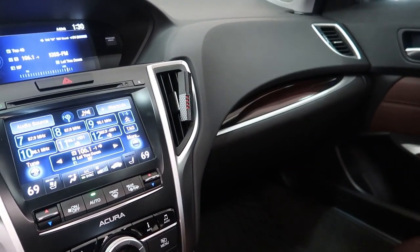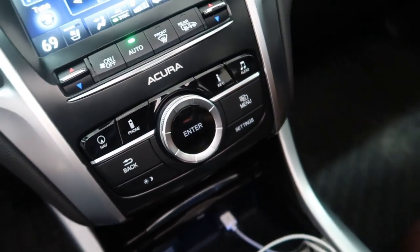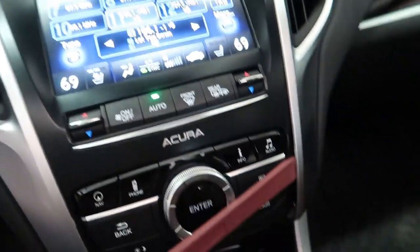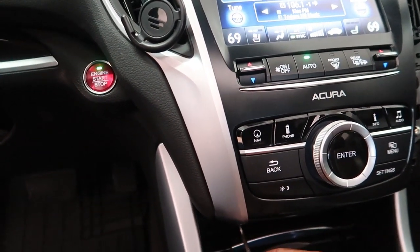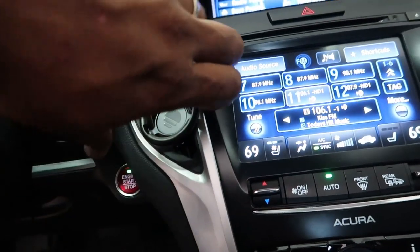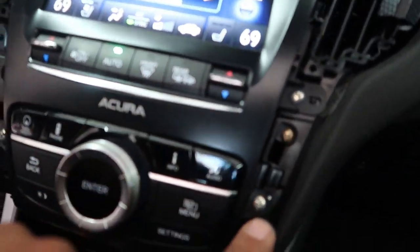I got a flat panel popper — pretty thick — and some other thin ones, and a hook to help me get some stuff out. So I'm gonna come down here right now, looking for the weak point. You can actually grab it and start pulling — you see that it starts to release. Once it releases, you can use the panel popper to start popping up the panel. You gotta be careful because it is plastic, not metal. I'm gonna do the same thing on the other side, then pull it up and start getting this panel off.